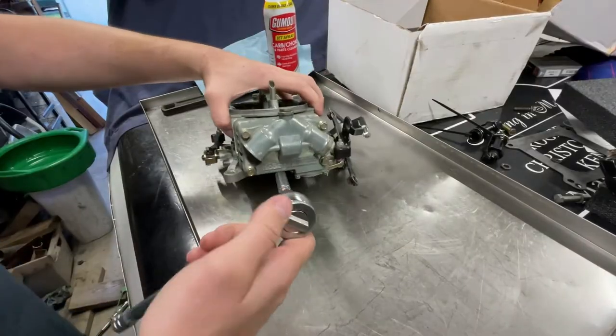And rags and safety glasses — these aren't safety glasses, these are just glasses. I know I sound like some kind of OSHA inspector, but when you're taking carb cleaner and spraying out the metering blocks and main body, there's going to be some weird orifice where you forget where it goes and you spray into it and it fires directly at your face. You do not want carb cleaner in your eyes — it burns like hell and it's probably bad for you.